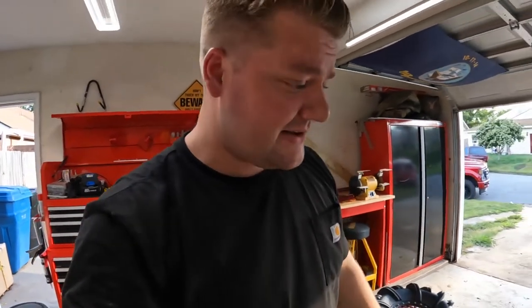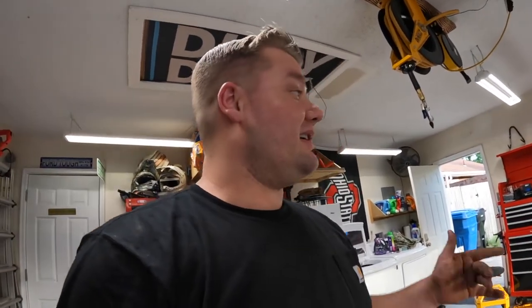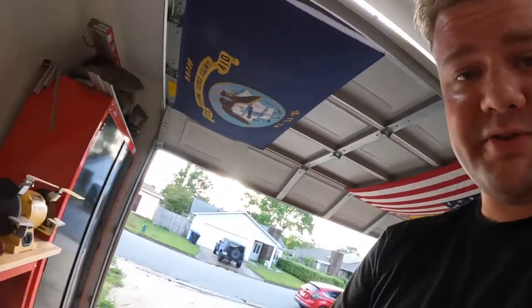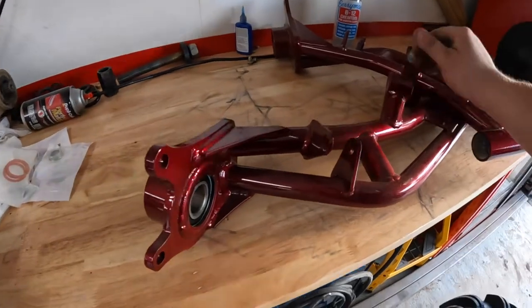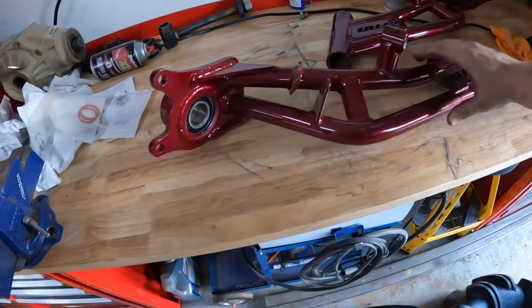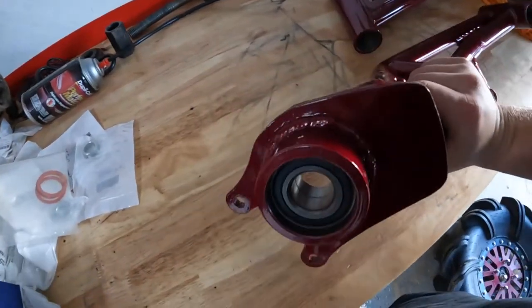That was a quick time-lapse - that's how you get the rear arms off pretty quick. If anybody doesn't know how to do it, leave a comment and I'll show you guys more detailed on removing the rear arms. It's hot out here! Now all we gotta do is get the upper bearings, dust seals, and spacers put into the new arms. I already pressed in the wheel bearings - here's the new CFAB arm.